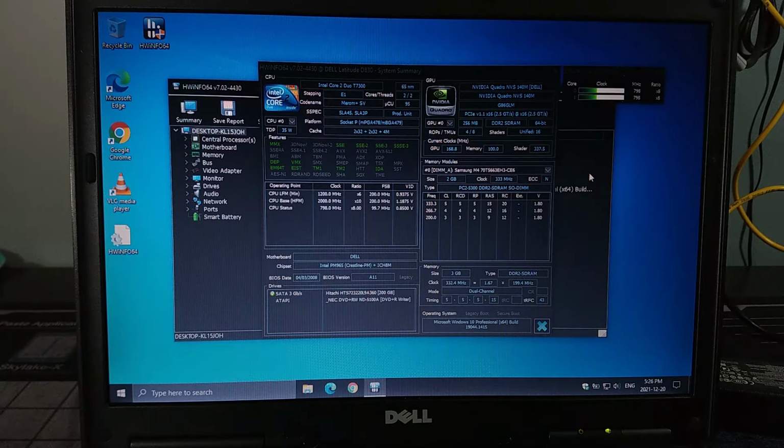So this is a standalone graphics adapter that's not using any of the memory that's in the system, which is good as well because I was only able to get 3 gig worth of memory in this. This is DDR2 RAM that's going into this, not DDR3. And I started to run out of SODIMMs in that capacity at 2 gig. So I have one 2 gig and one 1 gig in there. So total of 3 gig of RAM. So very good that we're not sharing any more of that memory for graphics.